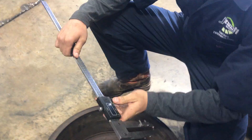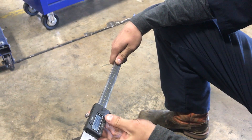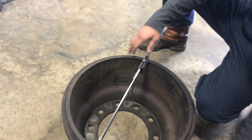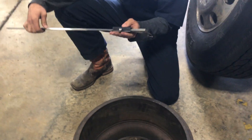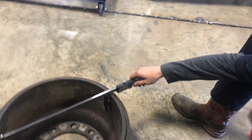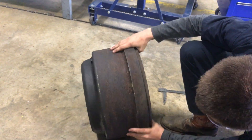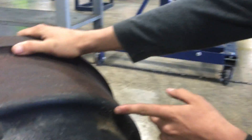We're going to measure the diameter of the brake drum. We're going to make sure it's zero. It's reading 16.4 and the spec is going to be on the face of the drum — max diameter is 16.6 — so we're still in spec.